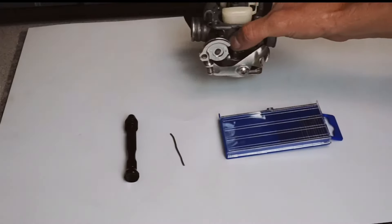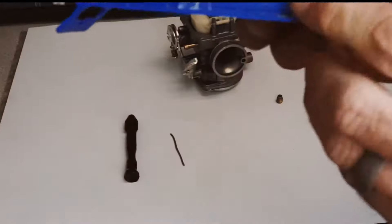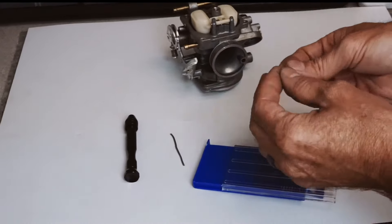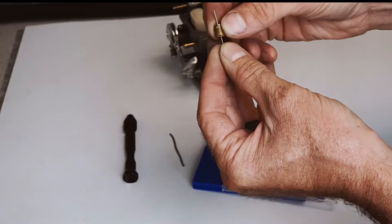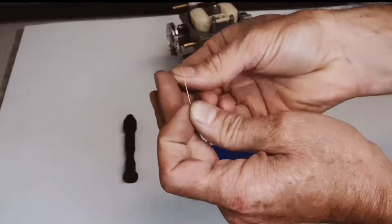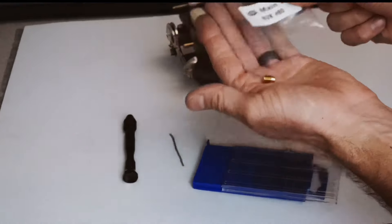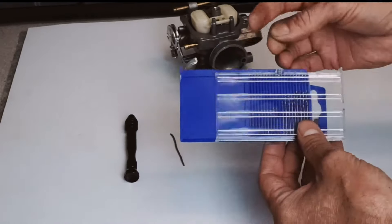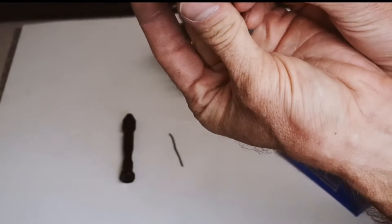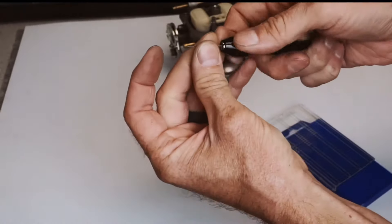Let's start with a Honda Ruckus carburetor. If you pull the jet out, the stock jet slides down — you see all these little numbers. You pull out your little drill bit and figure out where to start. I'll slide that in — it's a perfect fit, not a lot of wiggle. So if I want to go one size bigger, say this jet is a 75 and I want to go to 78 — instead of buying a brand new jet, I slide the drill bit over one notch, take my little hand drill, and start drilling.